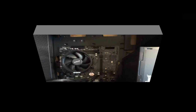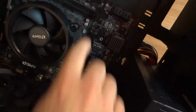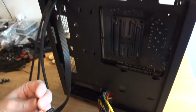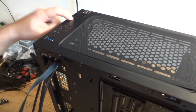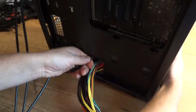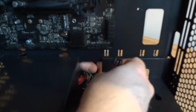Connect cables from the case front panel to the motherboard. They all gonna go here along the bottom edge. One gonna go here. So, taking those wires, I usually start with this one. Just make them a little longer. That's your power, reset, and LED indicators. I'm gonna put it through this hole to this side. Now, here's a block here that we're gonna be using.